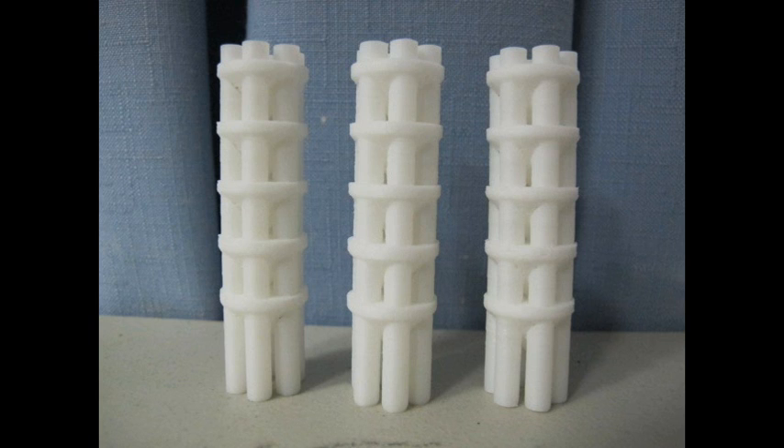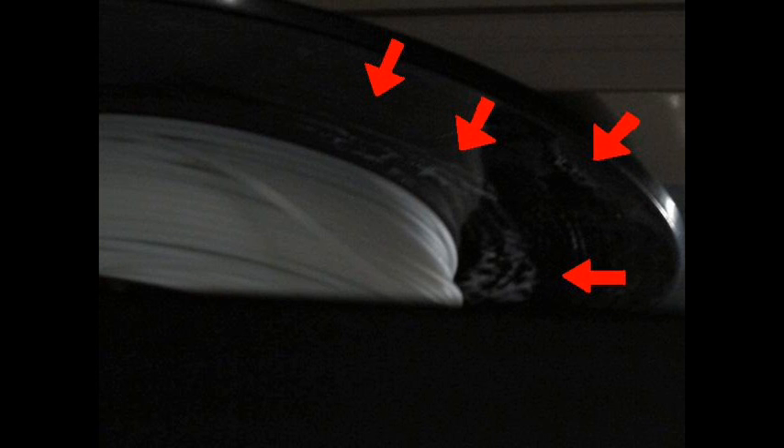So that's getting through a blocked nozzle and doing a full clean-out of the entire head. Not too sure exactly what went wrong when I wasn't supervising it. Still being new, I have a lot of questions. Looking at the spool at the rear of my 3D printer, I'm noticing a lot of dust deposit — the ABS is rubbing up against other strands and producing dust everywhere. I don't know how this is going to affect the internals of the machine, though there seems to be a sleeve inside to keep it out of the gears and belt drives. It probably explains why the stepper motor was absolutely trashed and full of white powder. This material can somewhat disintegrate, and I'm very interested to see if PLA behaves similarly.